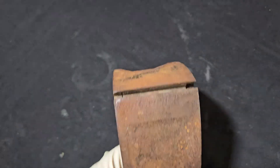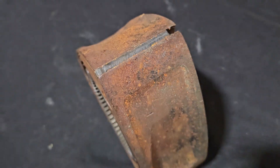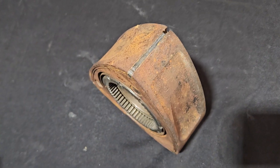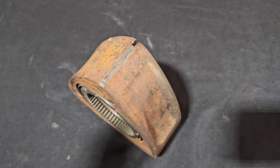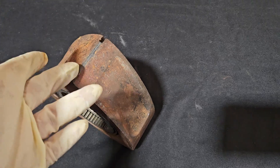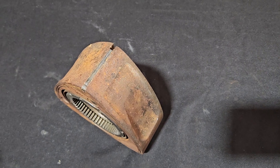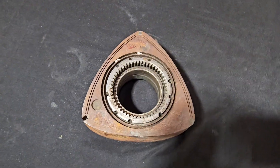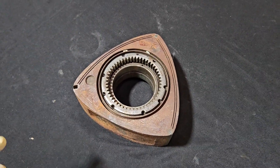It really does make sense. You can even see in this rotor — this is obviously a bad rotor — that carbon seal is obviously soft. And if you're familiar with the racing carbon seals that Mazda made, available from Australia, available from Japan, we used to have them here in the US — they're a softer material designed to not last as long, but they were very functional and often used in racing. So the racing ones could have been derived from these early production parts, knowing they'd have a lighter seal that doesn't last as long. But that was not good for production, and that led to a history of people assuming that the apex seal is a problem in a rotary engine.